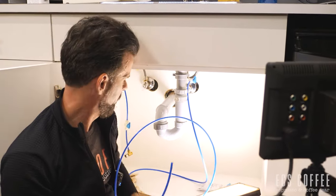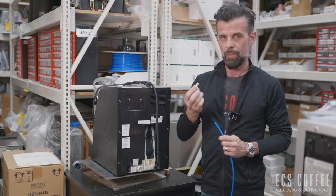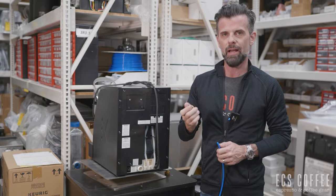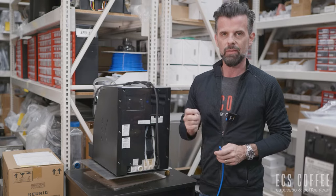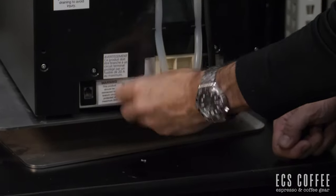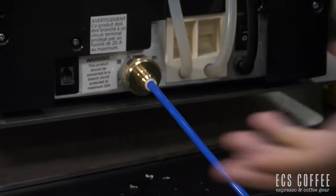We've moved into our service department because it's easier than working behind a sink, but imagine this is what's popped up above your counter. You've run the line from under the sink, drilled the hole, and this is what's coming up. Now we want to connect to the back of the machine. Remember that garden hose fitting — quite easy to use. This is a Keurig K3000, but the K3500 and K2500 are the same, as are many other commercial machines. Do check your fitting first as some have flare fittings or three-eighths connections. Wrap plumber's tape on the threads, hand-tighten like threading a hose, then shove the water line into the back and make sure it doesn't come out — and you're off to the races.